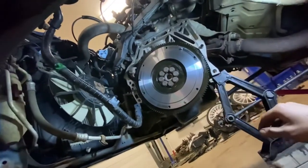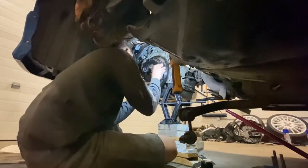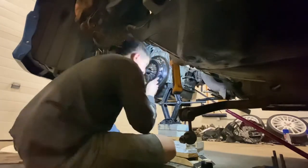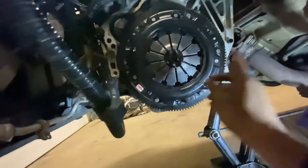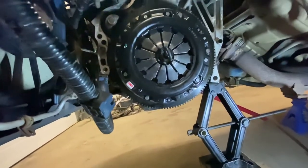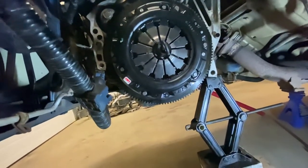You need to torque the flywheel. I'll go install the clutch plate and clutch disc. Clutch pressure plate, flywheel, and clutch lining are installed — it's a criss-cross pattern for both. For the clutch pressure plate, the spec is 19 foot-pounds of torque, but I torqued them to 24 foot-pounds just to make sure. Next step: installing the clutch release bearing to the clutch fork and to the transmission.